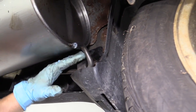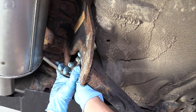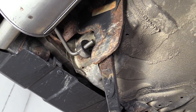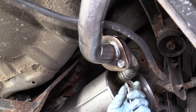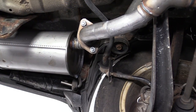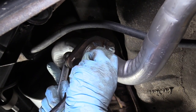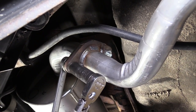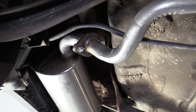I am definitely going to tighten up these two mufflers before I tighten that spring bolt kit because some of these hangers sometimes get bent in storage. I don't like the way that one's looking — I might end up having to pry that down, which is going to manipulate the angle of the pipe. So when you buy aftermarket exhaust, you've got to be prepared to do a little custom fitting and lining things up. So now I'm going to tighten the bolt and nut — they're 17-millimeter. Now I'm going to tighten the passenger side, then move over to those spring bolts in the front. Let's move down to the spring bolt kit and tighten those up.